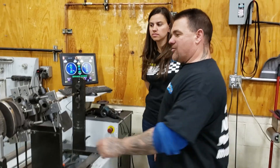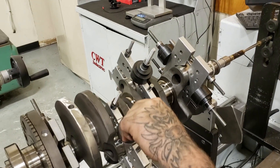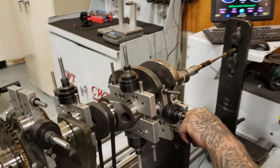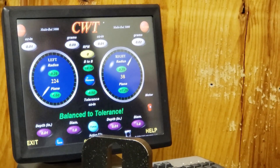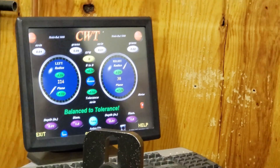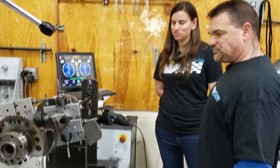A little bit more grinding. Our crank does not look like a beaver has killed it — we have small holes. We'll do a little deburring after, just deburring the hole so it's not a sharp edge. We were down to 0.09 and 0.02, so I would say this crank is pretty much near perfect. It is ready now to be washed, final cleaned, and mic'd up for setting bearing clearances. We'll do that next.